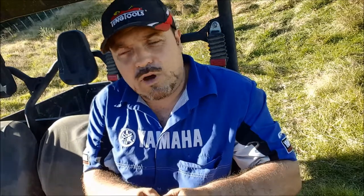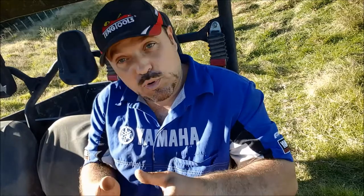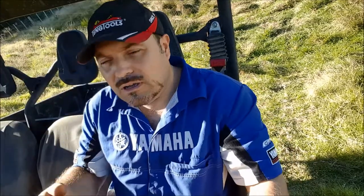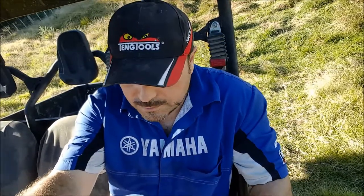In four-wheel drive at the moment, and I'm just going slightly across the bankside, probably about 25 degrees across the bankside. It's pretty steep, and we've got opposite corners spinning. So now if I engage the diff lock, that should give us additional traction to get to the top of the hill, hopefully, and that'll be categorical proof that the diff lock is definitely working.